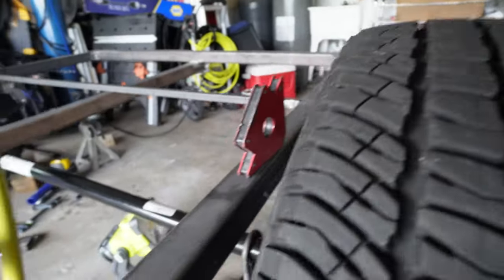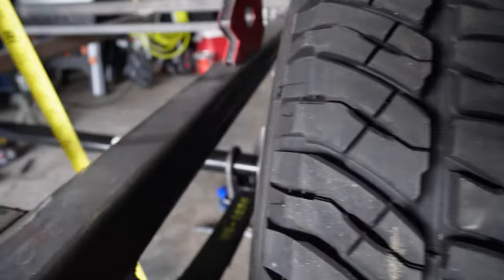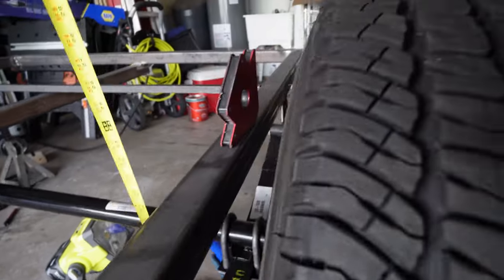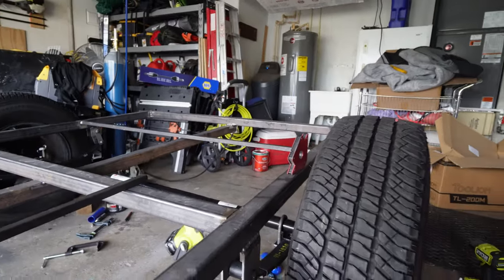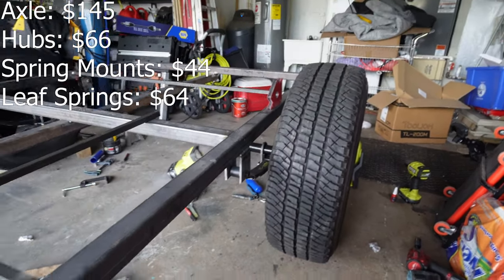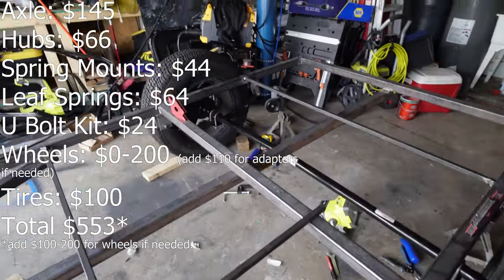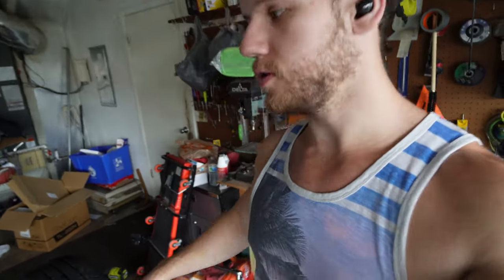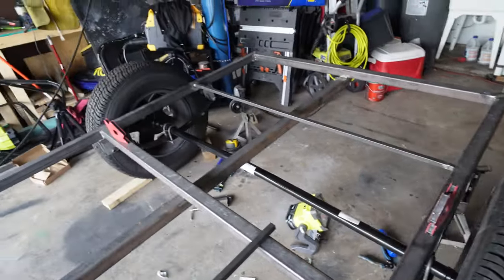At our axle, our lowest point, we are right at 15 and a half inches. And our frame — our body — is almost two feet. That's insane — we will not be getting caught up on anything. Quick overview with pricing: today we worked with an axle, hubs, the hanger kit, the leaf springs, the U-bolts, wheels and tires. Since I messed up and ordered the wrong hubs the first time it added more cost, but if you don't do what I did you'll save money. It looks great — we have just over two inches of clearance from our frame to the tire, which is perfect.